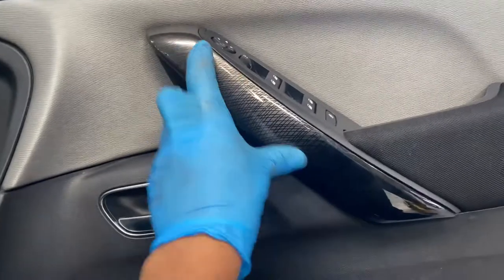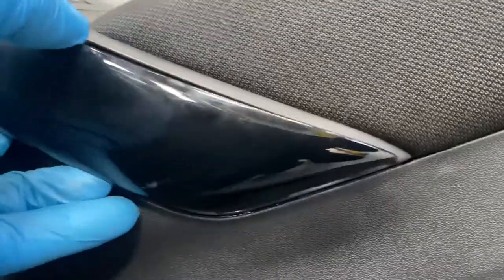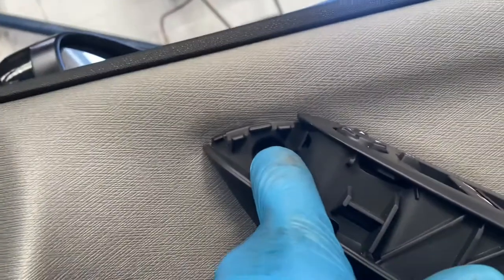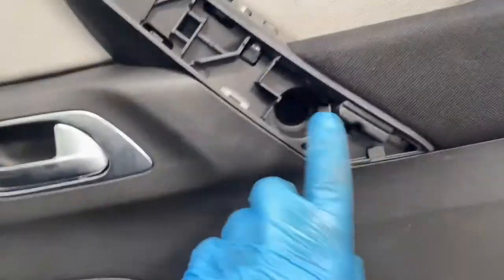As you can see, we've just removed this trim. There's a little slot beneath the bottom here — you just slide the trim remover tool underneath and unclip it, then it just pops off. It's got a torx screw just in there and one in there, so I'm going to leave those. The rest should pop off, including the bolts in the door handle.